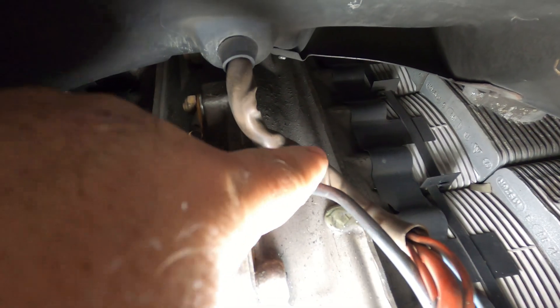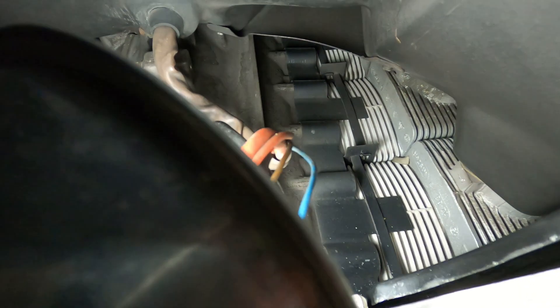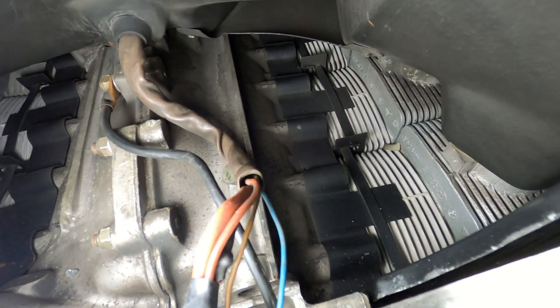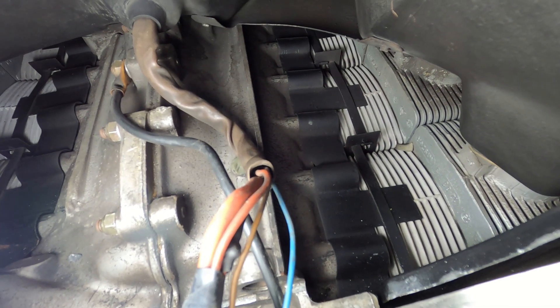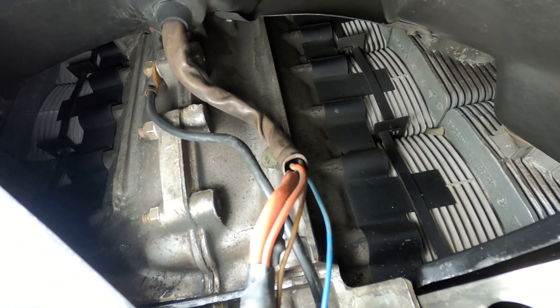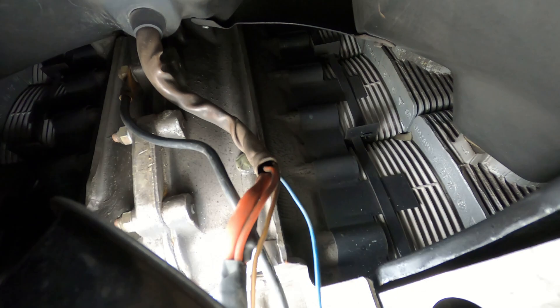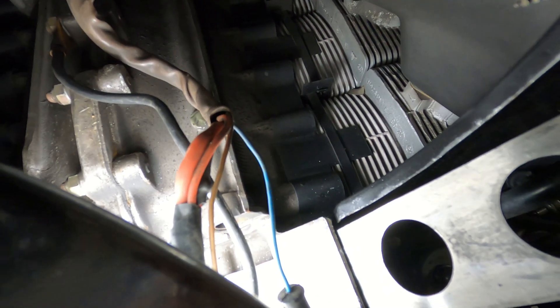These wires here are for the alternator. But then you have these air baffles, and there are ones on the top and ones on the bottom. It essentially controls the airflow through the upper part of the cylinder. So the airflow is restricted up to about here, but it can still go through the fins, and then it's unrestricted in the second half of the cylinder, which is interesting.